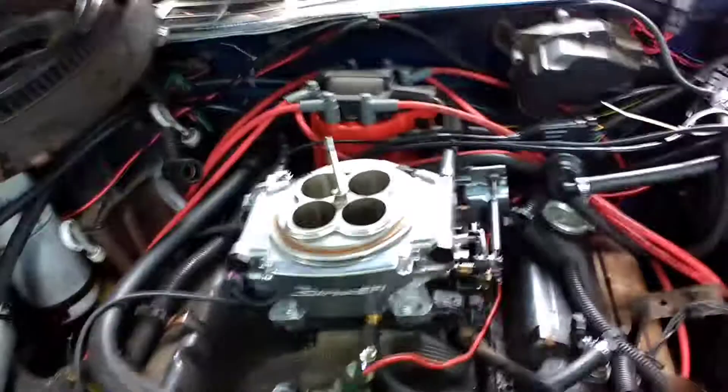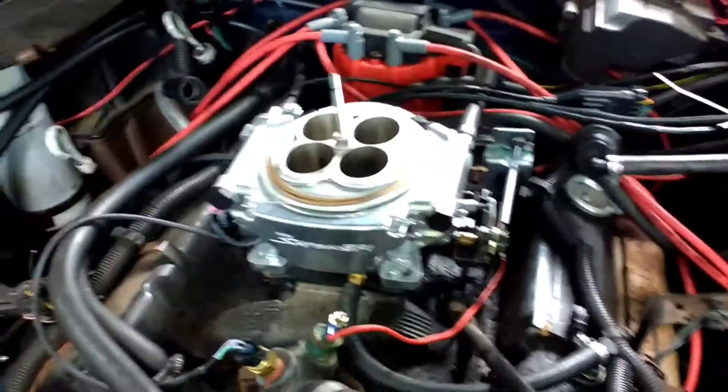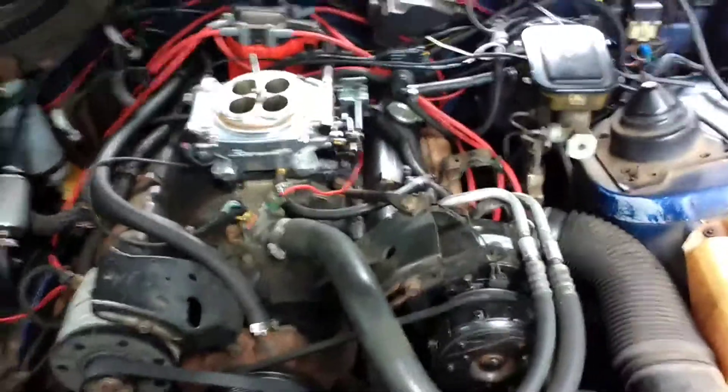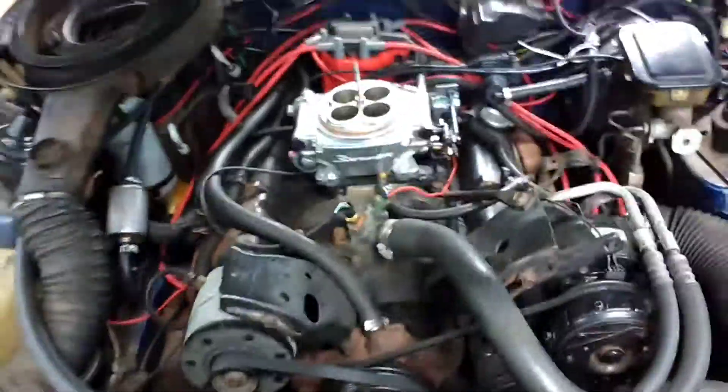You've got your wire coming over here, you've got your oxygen sensor wire going around there, and a few wires coming off for your engine management stuff. It's been on here for a few months so it's a little dirty. But it plugged right into the original temperature sensor connector that was already on the car. They give you the oxygen sensor, and the rest of the sensors like the TPS and idle air control are either in or on the actual throttle body.